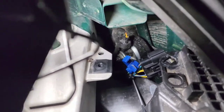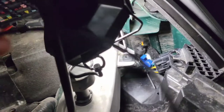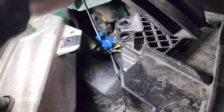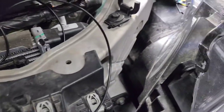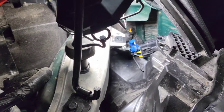This is going to be a little tricky. It's on the green and orange wire — you're going to take some kind of wire tap connector, hook it in there, flip it over, clamp it down, and then hide your wire wherever you want. We're going to run it up here to the top so I can zip tie it in place so it looks stock and everything's hidden.